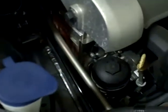Before you actually remove the oil filter, you need to get underneath the car and remove the plastic pan that is covering the oil plug. So this guy right here, what it's got is bolts, two in the front, two in the back, and two on the side, so six total. And in order to get that off, you want to use a 10 millimeter wrench.